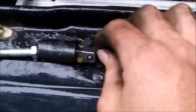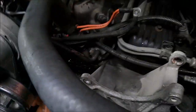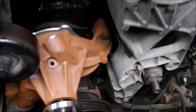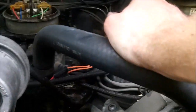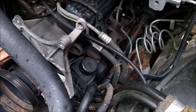And you have these 4 bolts in front, which I believe are 13mm. 3 hold it on, and you have another one that holds another bracket on for the oil lines that go to the oil filter. Now just go ahead and remove this big aluminum bracket. Or I might just leave the bracket on and just take the bolts out so it comes off the head. It really depends on how I feel like doing it later.